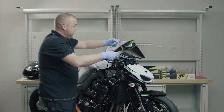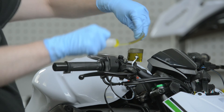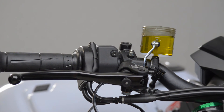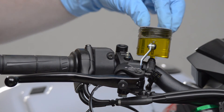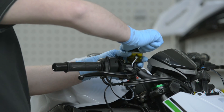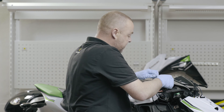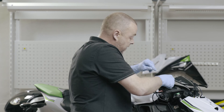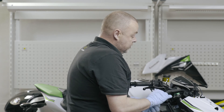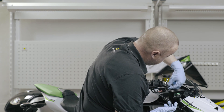The final thing is to set the level in the reservoir — fill it to max with some fresh brake fluid. Brake fluid should always be fresh from a sealed container. If you do have a spillage of brake fluid, use copious amounts of water on it, because brake fluid is attracted to water and it's the best thing to dilute it. The very last job is to put the little dust cap back onto the nipple, and then to connect the brake light switch up to the wiring loom on the vehicle.